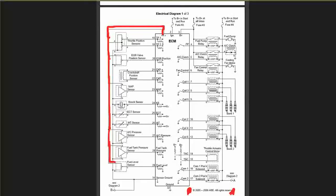Now with every circuit, you've got power and you need the ground. We have the 5 volts going into the throttle position sensor, then to the EGR, then into the MAP, the AC, the fuel tank pressure sensor, and the fuel level sensor — 5 volts being tapped into those circuits. So that's 1, 2, 3, 4, 5, 6 sensors.